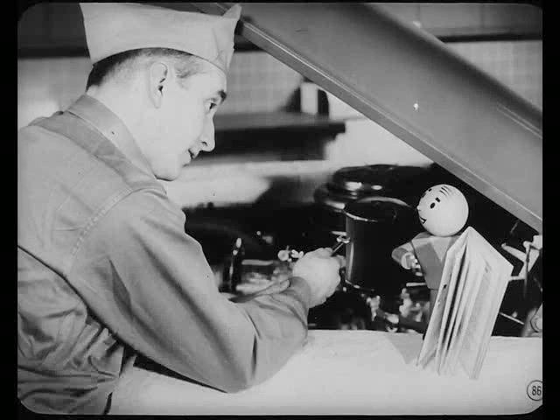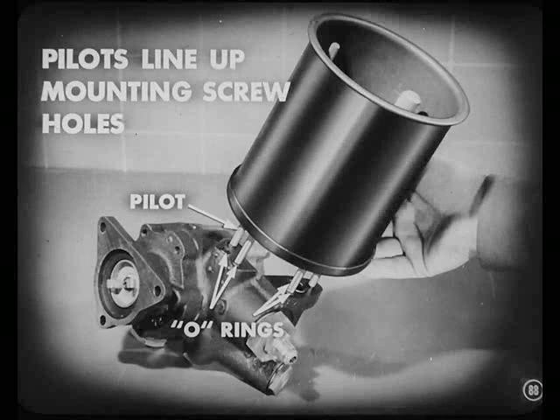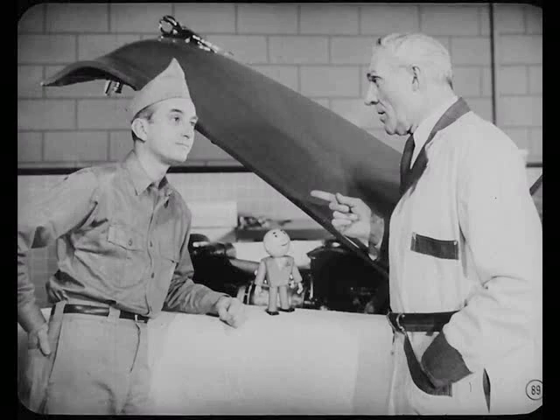Some parts of the pump and reservoir — like the bearings, the pump shaft, the oil seals, and the O-rings — can be replaced. You'll find the details on pump service in the reference book. For O-ring replacement, start out by inserting these special tapered plugs and pilots into the oil passages and screw holes. Those plugs for the oil passages are to keep dirt from falling into the pump. The pilots are used to line up the reservoir mounting screw holes so the screws won't cut up the O-rings. When you connect the hoses between the pump and valve body, be careful not to connect them to the wrong fittings or you'll blow out all the seals.